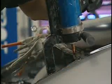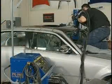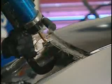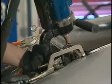Welder settings will vary when welding through wet versus cured adhesive. If a test sample through cured adhesive was not made, use the welder manufacturer's recommended settings for welding through cured adhesive. Once the first weld is made, continue welding, maintaining the original spot weld spacing. Welds should be placed as close as possible to the original spot weld location, without overlapping the original weld site. Do not place a new spot weld directly over the original weld location. Remove the clamps and grind down any remaining adhesive from the cosmetic repair area with a DA sander or angle grinder.